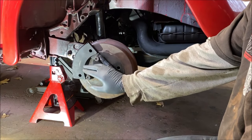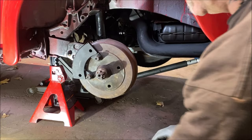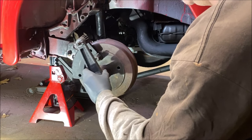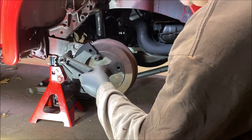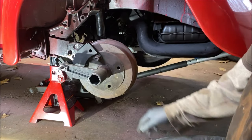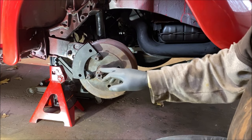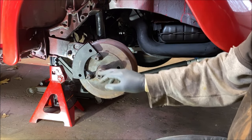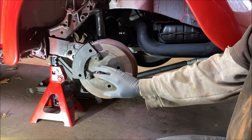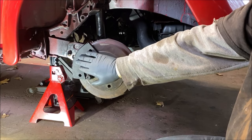This thing is a must. And when you're doing the flywheel like I showed in a previous video, it just saves such a hassle. And if you have to get one loose — obviously we got one of them stubborn ones — put this on here. You put your breaker bar on here with a 7/16 socket and you will get it loose. Always remember when you're trying to loosen one that's been on there a while, take a wire brush, clean up the best you can around here especially these threads hanging out, spray some PB Blast on it and let it soak maybe even for an hour. Hit it again, let it soak for about an hour, and then try to break it loose with your torque multiplier and a breaker bar. Chances are it's going to come right off.